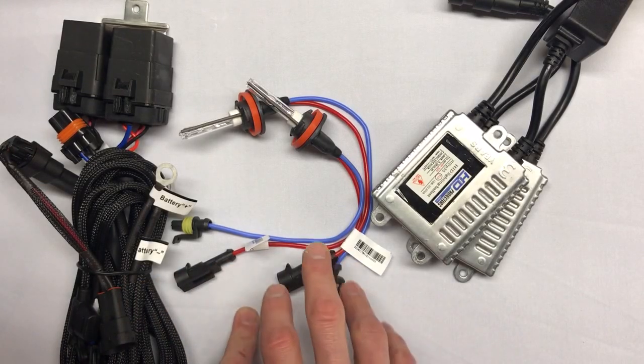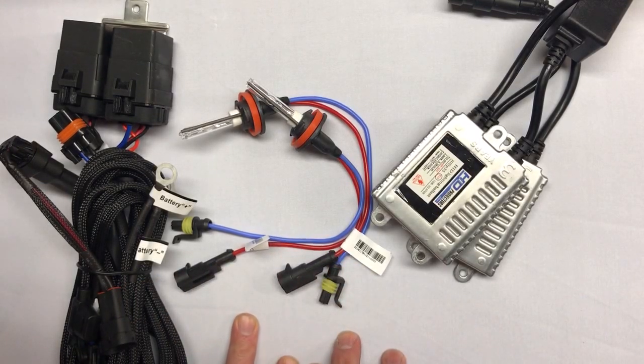The bulbs here in the middle — we've got three options. They're all from CN Lite, which is, in my opinion, the best aftermarket bulb option for the Tacoma. We've got a 4300, a 5000, and a 6000K bulb option. The 4300 is going to have more of a yellowish OEM look to it, and the 6000K is going to have a little bit of a bluish tinge. As far as performance, they're all fairly strong, although the 4300 will probably perform better from a lux standpoint.